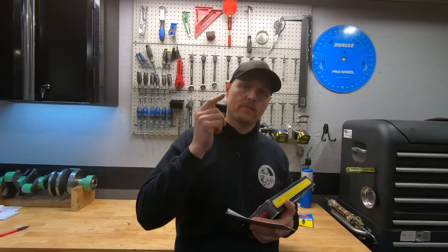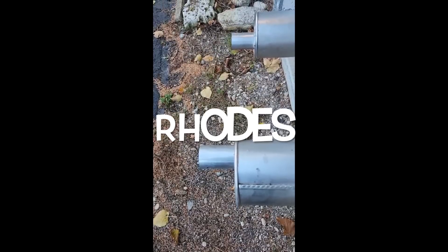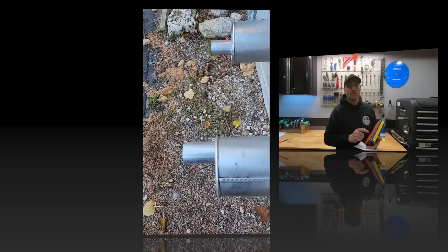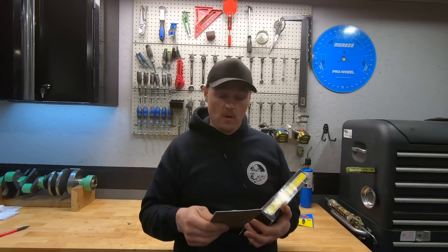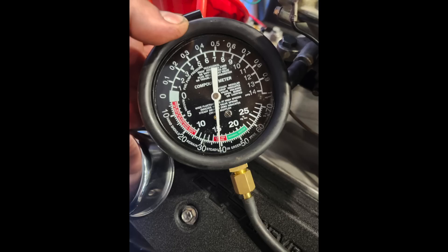I'm going to play back to back the idle sounds of first the Delco lifters and then the Rhodes lifters so you guys can hear them back to back. Their claim of more vacuum did happen and a smoother idle did happen. So those guys that love the sound of the big cam might not be happy, but the guys that like their power brakes - it just went from 11 inches of vacuum to just over 15 inches of vacuum. That's a huge increase.